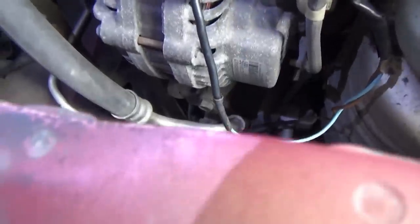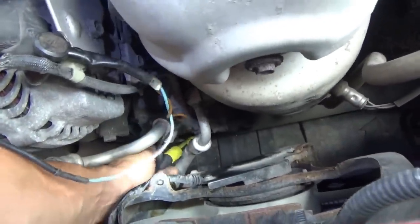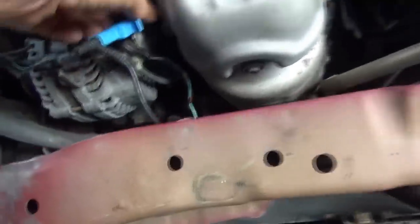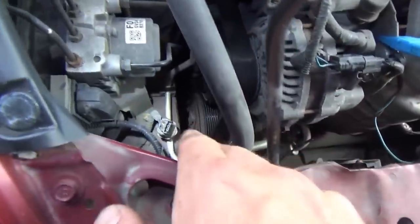Take this off — no continuity. So there is a problem with this AC clutch coil. There's a possibility it could be a bad ground from the coil, but putting the test light on the ground wire shows no light. So this air conditioning clutch coil is open. Very quick, very easy — no meters, no scopes, no scanners. The clutch coils are sold separately; you can find one on eBay if you don't want to replace the whole compressor. We'll tell that to the shop owner and move on to the next one.